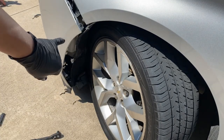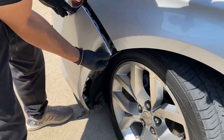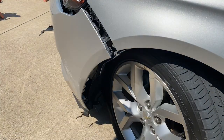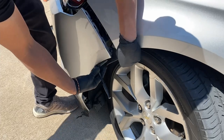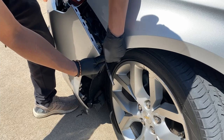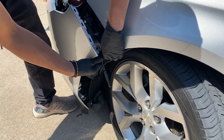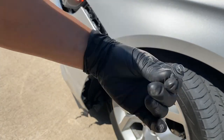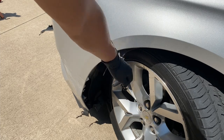There are usually four of them and then two underneath. If you guys look right here, there's a bolt right there but it's usually pushed up and underneath — it's going to be a 7mm. Usually you go ahead and move the fender liner to the side and then go in from there. Mine is exposed so I'm just going to take it off like this. That's how that bolt looks — mine was already showing but it's usually underneath here, so move the fender liner back.